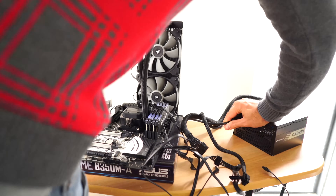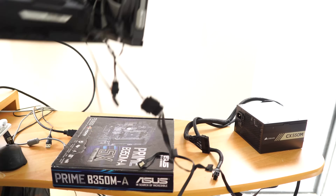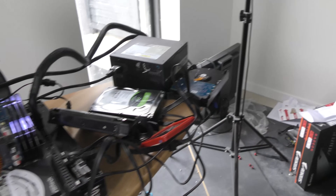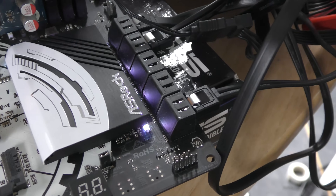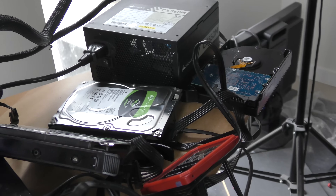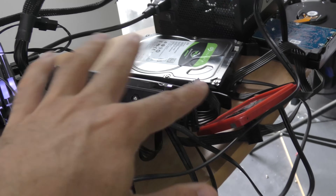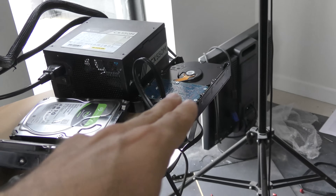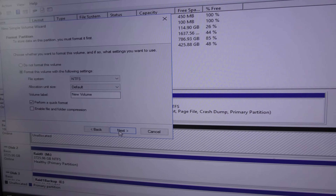Maybe that's one of the reasons why in the server industry people just don't want to change hardware at all. Here's what we've got to fix the RAID problem: I've got a two terabyte hard drive running off the main chipset on a different SATA controller, so it'll just be a standard drive installed normally on AHCI or IDE. We're going to get all the data off the RAID drives, copy just the stuff I need to that drive, then reset the RAID array, and hopefully it'll be happy days.